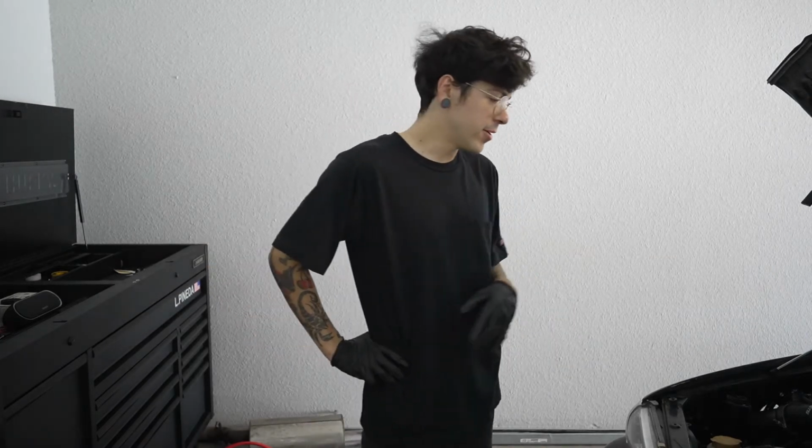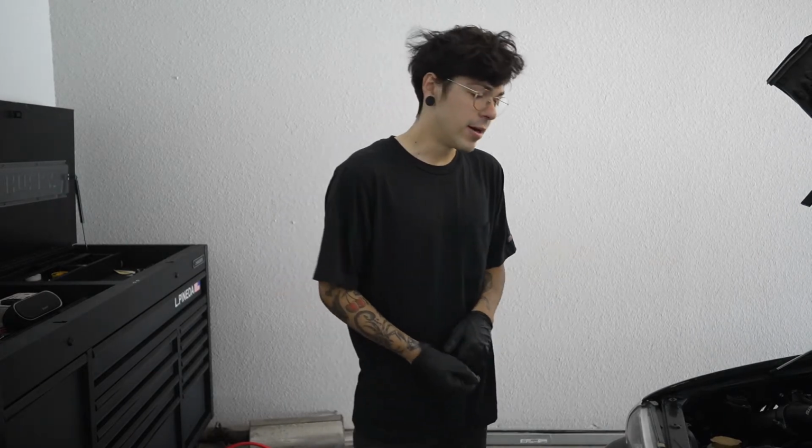It is the morning now. So what we're going to do is bleed the cooling system. To start the bleeding process, I always recommend to fill up the radiator first. Once you fill up the radiator, burp it out of any bubbles that you see. So pretty much you're going to massage the top hose and just make sure there aren't any more bubbles coming out of the little fill tube that is on your radiator. Mine doesn't have a radiator cap on the top, so I don't have to worry about a radiator cap there, but there is a 17 mil that I do have to take off.